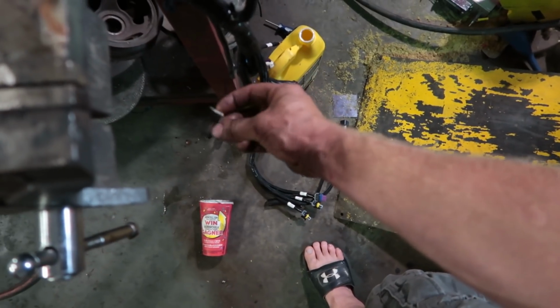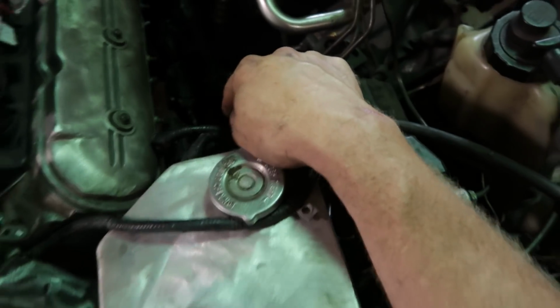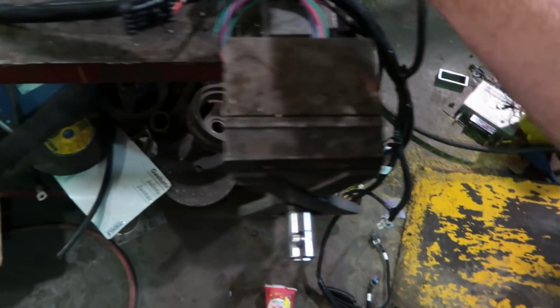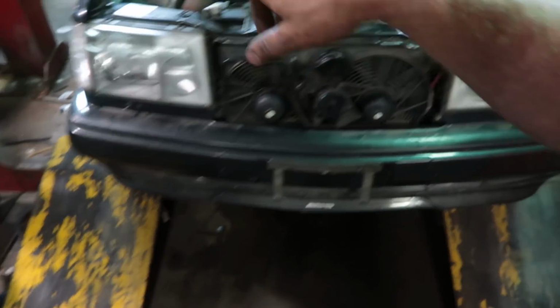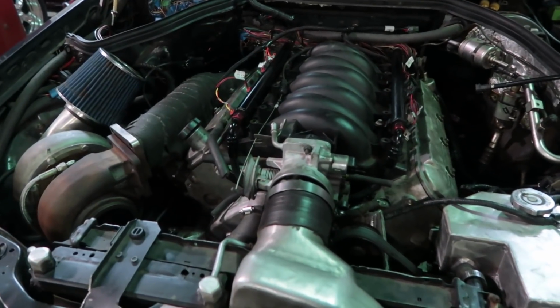This ground goes to your cylinder head for your coils or your spark plug. Again, it's very late at night, so sorry if I'm mumbling. I've got my coils down below, hidden nice and neat. So down below there. So first thing I am going to do is pull my ignition even and my ignition odd out of the harness all the way back. So I'll pull this loom off. And then I can run them separate only because my exhaust gets in the way on the Mercedes here.